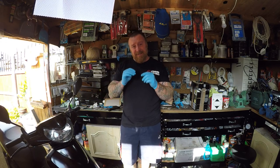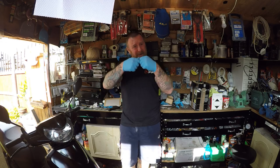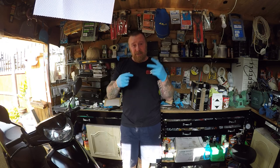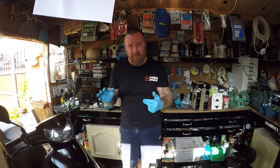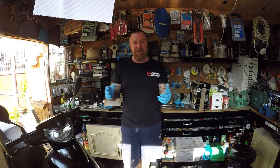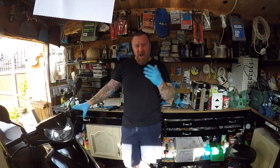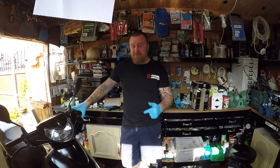On the side stand there's a sensor — two wires go into there. I disconnected it and plugged it into itself. The amount of times you leave that stand and the button on it goes wrong is too many. The next one is the kill switch — two wires one side, an orange one the other side. I'm going to cut that to make sure it doesn't work, because I can't have it accidentally switching off. Once you try and start a bike for ages with no electrics, it floods and just messes the bike up. You've got the key — you don't need these on these bikes. I'd rather they spent a few pounds more on getting the engine better rather than these little extras.